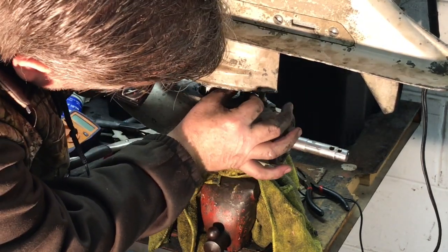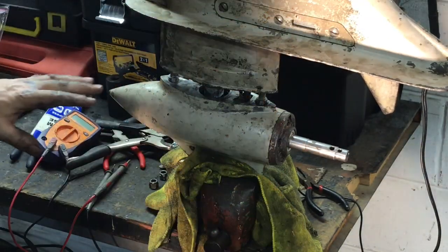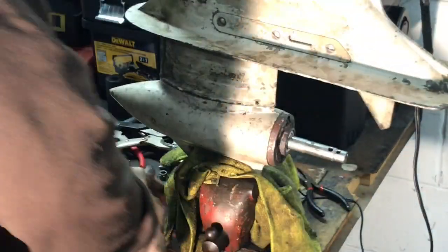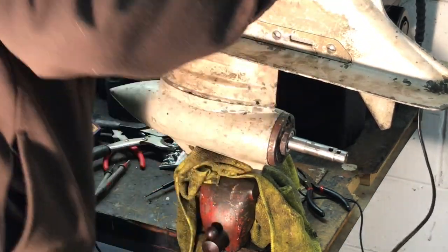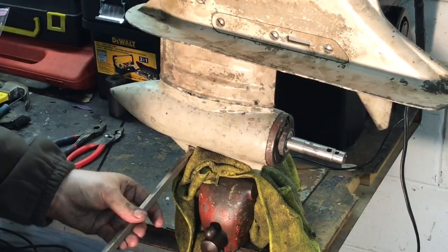I've got the blade connectors back in place, a little bit of grease around there, and the bearings are in. I'm going to drop it down, seal it up, get the nuts back on, and it should be ready for pressure testing. Technically you're not supposed to reuse these nuts — they are prevailing lock nuts with nylon inserts that shouldn't back off — but the manual recommends replacing them every time. I'm not going to, and I'm going to pressure test this like I did before.